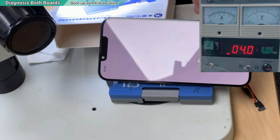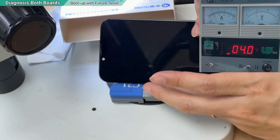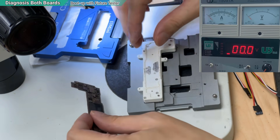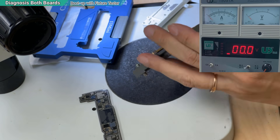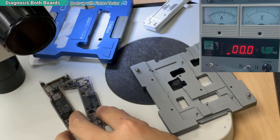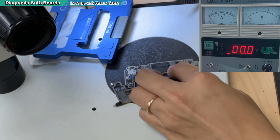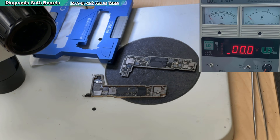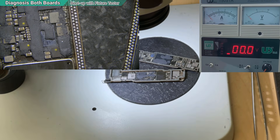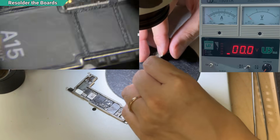The owner didn't give me the password so I can't test anything. But at least I can see there is no SIM error, which means the baseband is working. After we dismantle the layer, it is able to turn on. So it seems I don't need to repair anything — I just need to re-solder and install it back together. If it is able to turn on and is working again, then the problem may be the connection between them. This case is very rare; usually there is something broken after disassembly. I don't see any damage here, so I will re-solder and put it back to see how it goes.